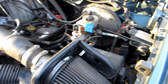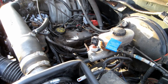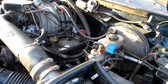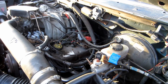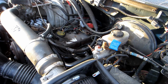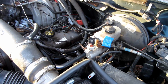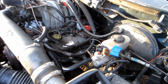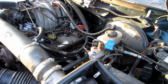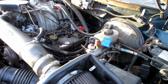I got some of my low end torque back. Before, I had the shorty headers, those Flowtechs from Summit, and they were approximately $180, something like that. They bolt up to the factory manifold, factory Y pipe. I had a 2.5-inch Y pipe made, no catalytic converter, into a Y that went to a 3-inch, and the 3-inch went back into a welded muffler, and then 3-inch out the rest of the truck, all the way out to the side. And that's what the previous part of this video was, it running.